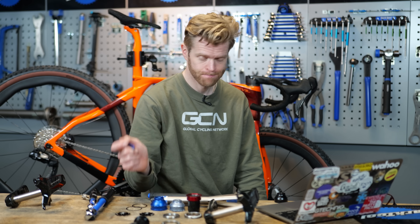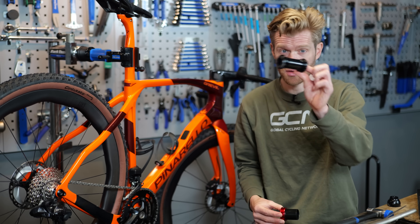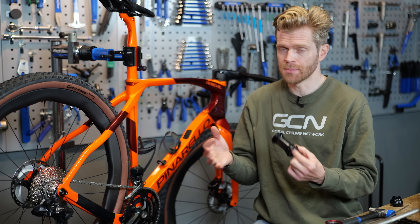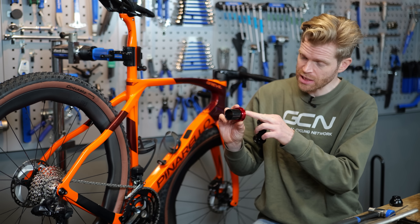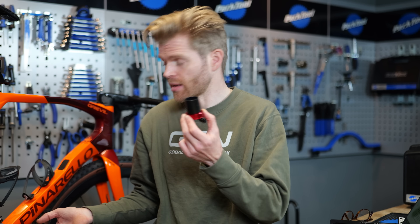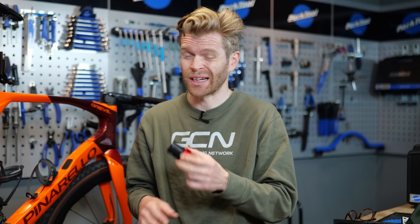Number four is excessively tight bearing fit. This can occur when you have too much pressure on the inner or outer race of the bearing, caused by several things. Firstly, it can be caused by your bike frame — this is generally more of a problem with press-fit bottom brackets rather than threaded ones, because it's much easier to machine high tolerances with metals and alloys compared to carbon. A press-fit bottom bracket is generally pressed into a carbon shell. If the cavity that the bearing is pressed into is too small, even ever so slightly, it can create increased wear, friction, and reduced bearing performance. This is usually a warranty issue for the frame if it's not up to standard.